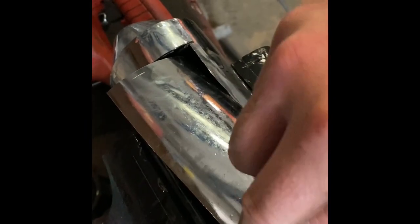On the other side it has one also — this one was tack welded on this side, the other one was tack welded on that side. They're kind of at angles — if one's up here usually the other's down here, though it may not be the same in all cases. Since I've already broke that one free, this will kind of wiggle. Just wiggle it back and forth a little bit and you can see where it broke that weld off.